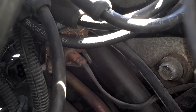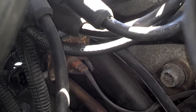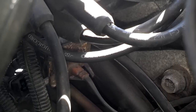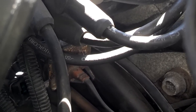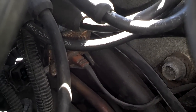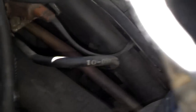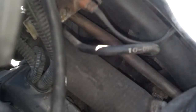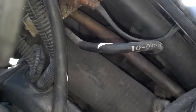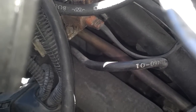If you look down at that orangish colored plug, that is the cam position sensor — it's in a special bracket secured to the motor. It's real important to keep that cam sensor connector plug protected and not just have it dangling around in there. Just below that is the crank sensor connector; it's white, and it's also clipped in a bracket attached to the motor, so you want to keep those things secure and not have them flopping around.